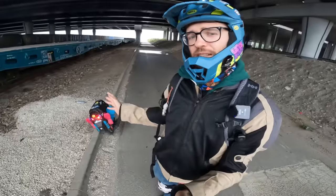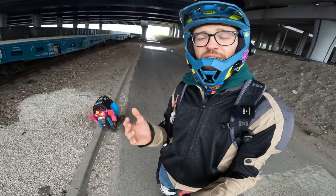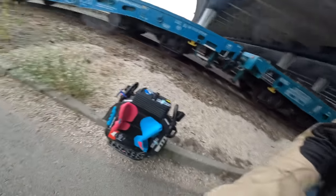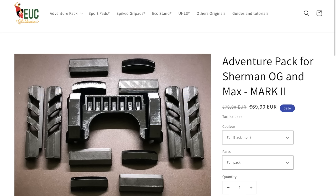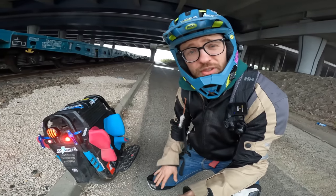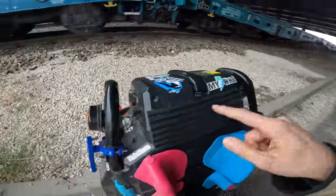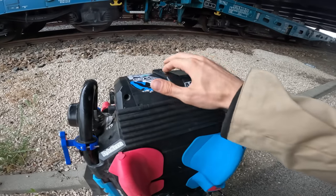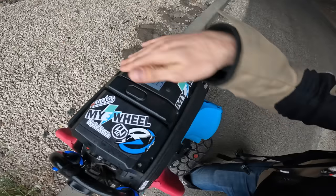Charging out of the box is relatively fast at around 6–7 hours; with an additional fast charger it's 3 hours, or with a 14-amp charger closer to 2 hours. Now for the biggest cons: first, the roll cage can rust, which is a bit of a bummer — best to put some accessories on it to keep the wheel in good condition. Waterproofing is actually great overall, with just some air vents underneath the board and some creases where water could potentially enter. There's a 3D-printed pad available for this. The buttons are also a potential water entry point — it's best to put some tape over them.